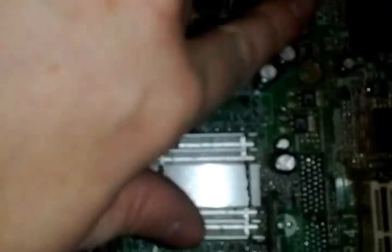Second is RAM, and I believed he already had it maxed out — incorrect. This is your RAM. These tabs right here — you're going to want to push down on that side and then push down on the other side where the cluster of wires is. There are only two channels you can put the RAM in.